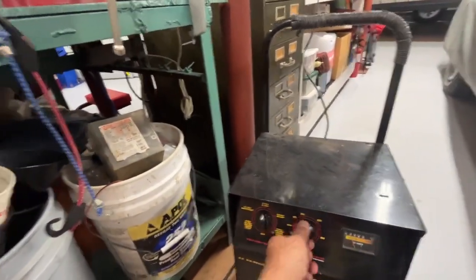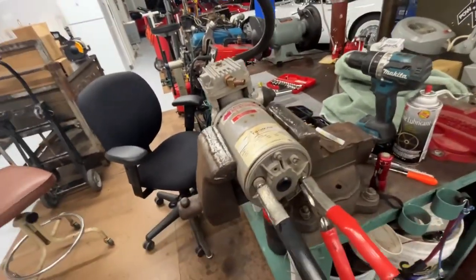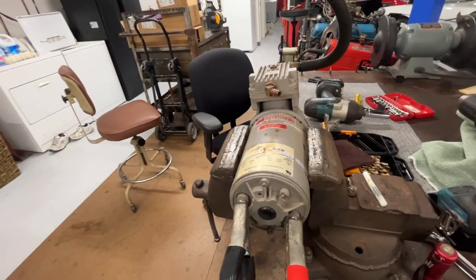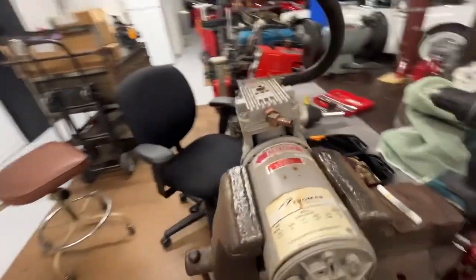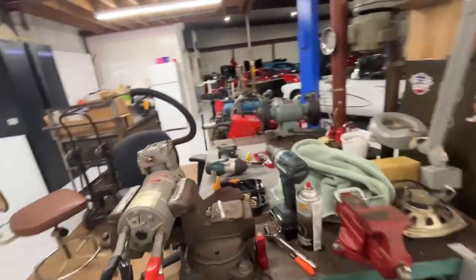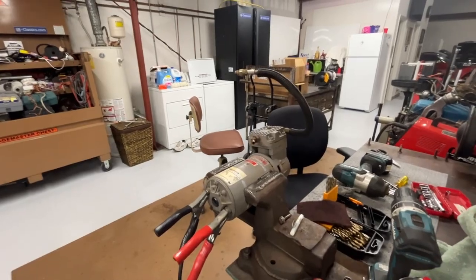Just got it on a battery charger there — and it's working. It would not work at all before, so it was just a brush that was stuck. From what I understand, you can get the brushes for these if you need them, or check yours. Getting a civilian one of these is not easy in the 12-volts, because an Alpha had to die for it to become used, and Alphas don't die cheap. So that's an easy repair — I was amazed. That's all it took.